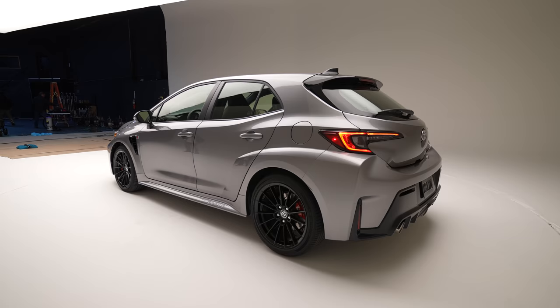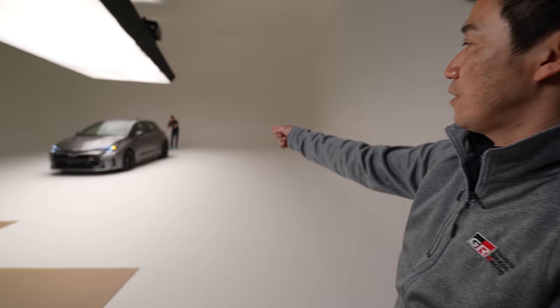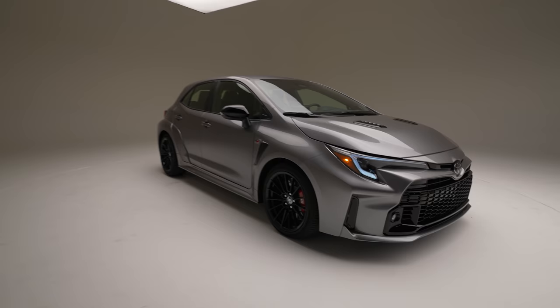So I can take this on track and drive it without heating issues. There's also a lot of interesting aerodynamics here — tell me about the aero. We put a flat bottom with many panels below the car to create a ground effect. The ventilation for the hood and fender also helps stabilize the handling. It basically reduces lift and makes the airflow smoother.